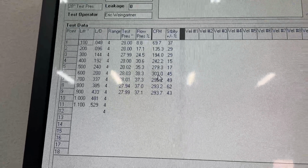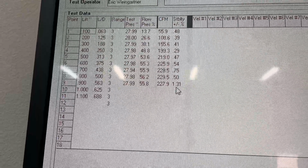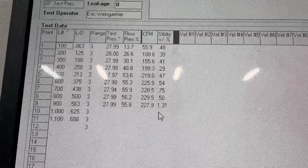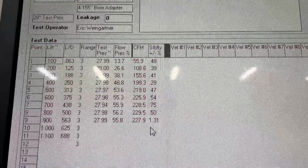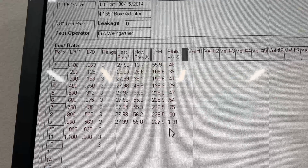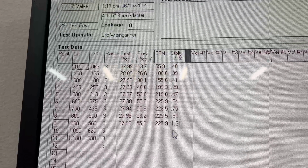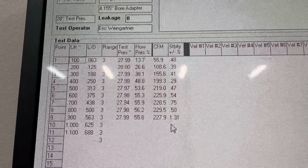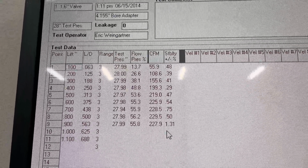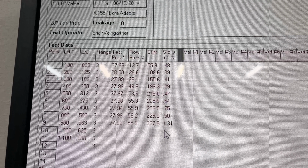But let's look at the exhaust. All right, here's your exhaust. Now, AFR flows them with an exhaust pipe. I do not flow them with the exhaust pipe, and someday I'm gonna make another video where I show why I don't. Exhaust flow numbers generally aren't that useful anyway, but when you flow them with an exhaust pipe, it really becomes less useful, because I can flow this with a 1 7/8 pipe. I've got one. And then I can flow one with a 2 1/8 inch pipe. And the 2 1/8 inch pipe attached to this will flow even more. On a live engine, it will run like a turd. So anyway, I don't flow them with an exhaust pipe.